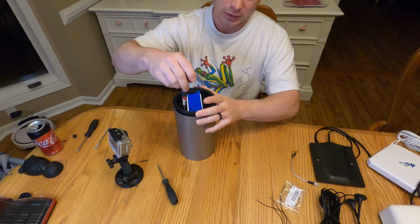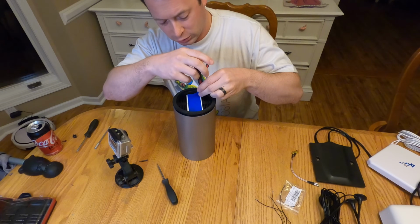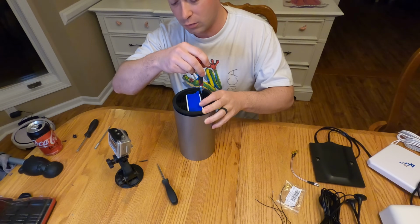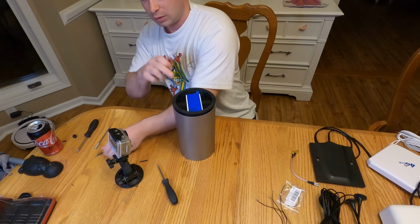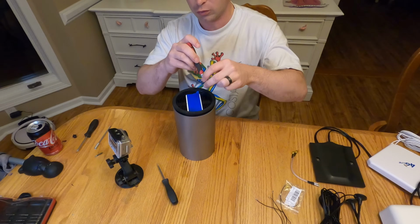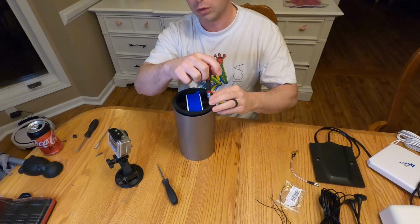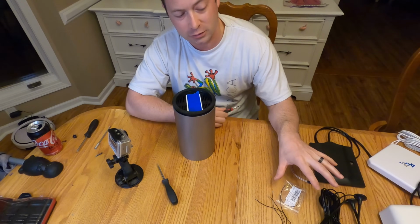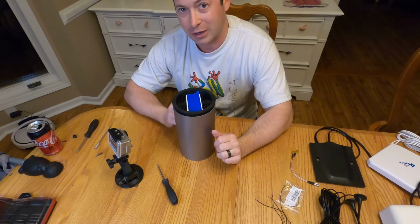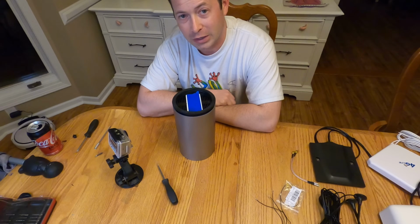Now what I did, like I said before, is I had the 2 wires dangling out here, and then you can hook up an external antenna. What you might want to do that for is if you don't get good signal in your house, or if you want to place the gateway unit someplace that doesn't get good signal, but you already know where you can get good signal somewhere else. So I will follow up with a video going through what I found between all these different antennae, as well as messing with the internal antennas. I started playing with those to see if I could make them more directional, since right now they are all around in a circle kind of facing out.